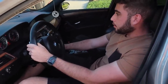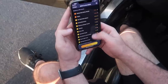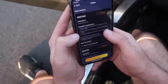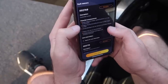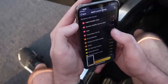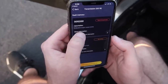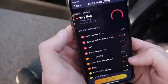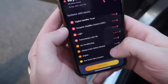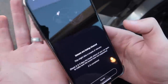I'm going to grab my code reader and see exactly what codes are being thrown. We have a few codes here — none directly flagging the engine except one: crankshaft sensor, potential consequence being power reduction and speed limitation, and the engine may be difficult to start. We also have camshaft bank one, power management battery, and two major transmission codes. I'll go ahead and clear all the codes and see if we get anything different after installing the new sensor.